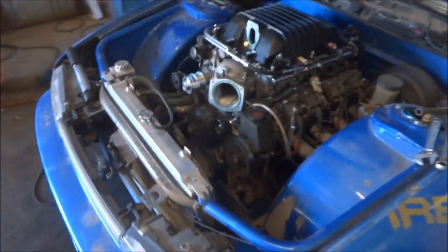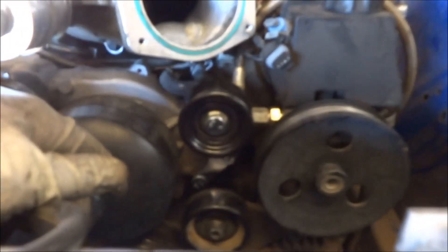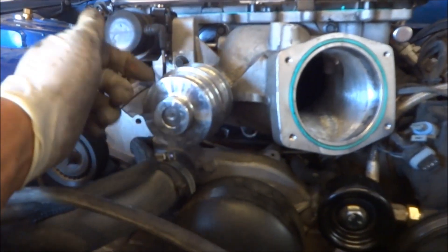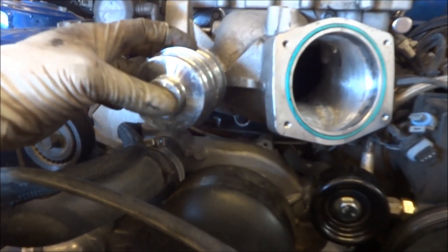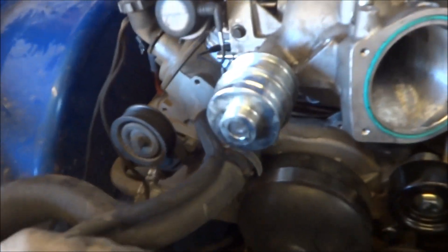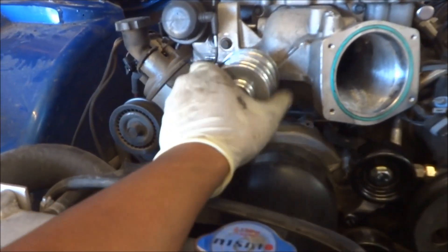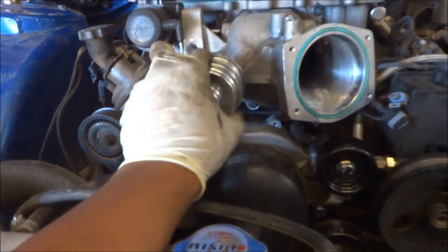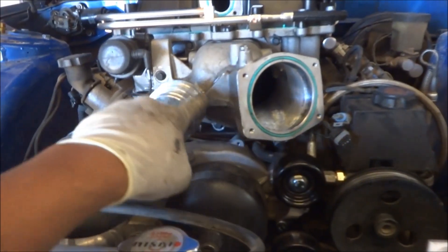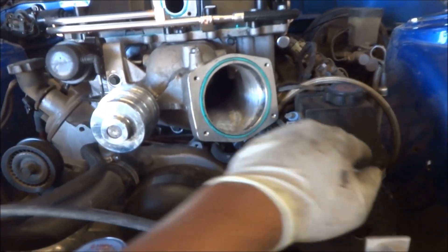I got the idler pulley from the Olsen Custom Works kit. When you order it from them, it comes with a bracket in the back that bolts onto your water pump, an idler, and a 2.4 pulley. I had to trim mine down on the inside of the snout — I ground it down with a rotary tool before pressing it on all the way. It spins and feels fine, no binding. I also did a solid isolated bushing as well. The belt comes down through here and then runs around the power steering pump.